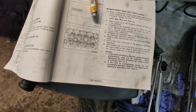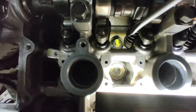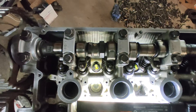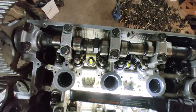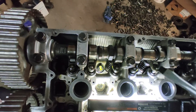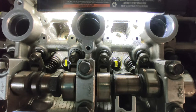This is the Mitsubishi factory rebuild manual — no arbitrary high torque figures. It tells you not to over-torque. That is your final torque, and this applies if you're using factory bolts or brand new factory-spec bolts. If you have ARP studs, different specs apply. Similarly, if you're using a head gasket other than OEM spec, you'll need different torque values — the thicker the gasket, the less torque you need.